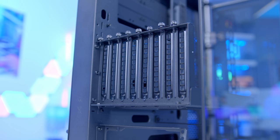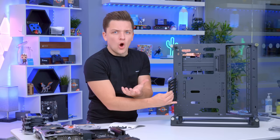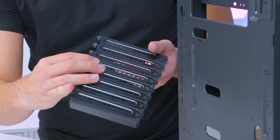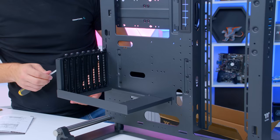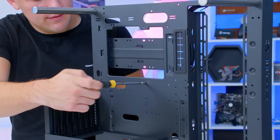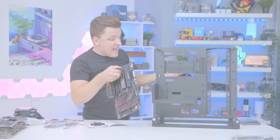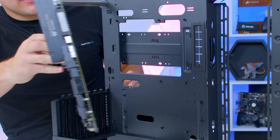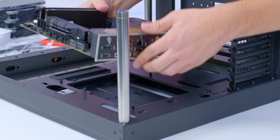It's getting better actually, and I'm more impressed by the moment. Also included is our GPU bracket, which can either be mounted horizontally for standard GPU orientation or vertically for a vertical card. While here, I'll also add in the standoffs for the motherboard. We've got an EATX board, so we follow all the holes labelled A — three along the middle, three across the bottom, and three down the top. Getting those in now saves us a step later. You can see why I've gone for an all-black stealthy motherboard design rather than something with gold accents.